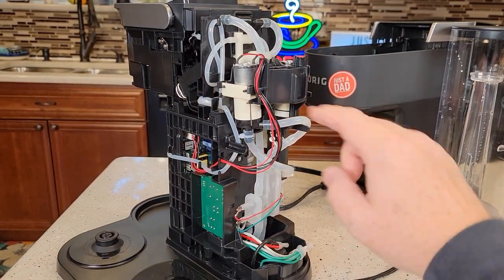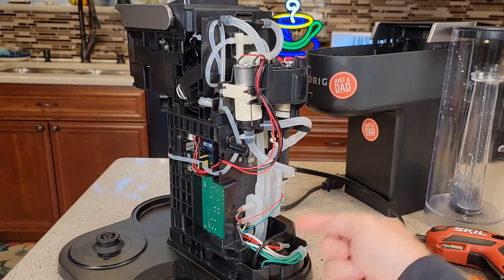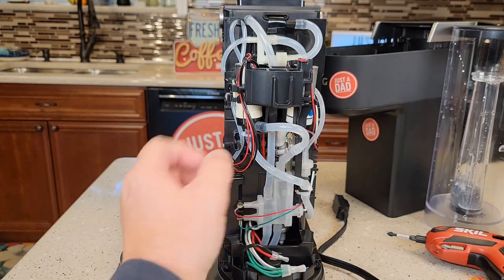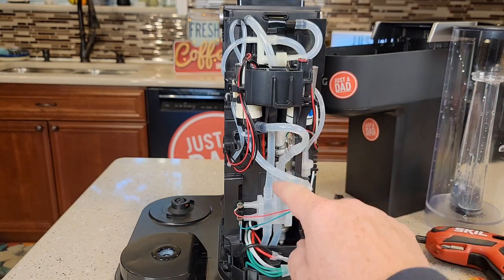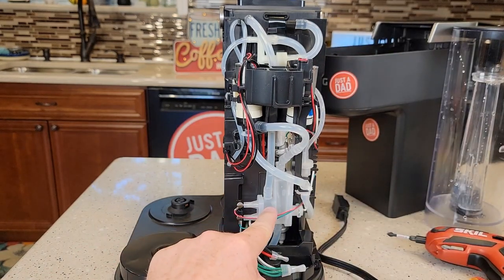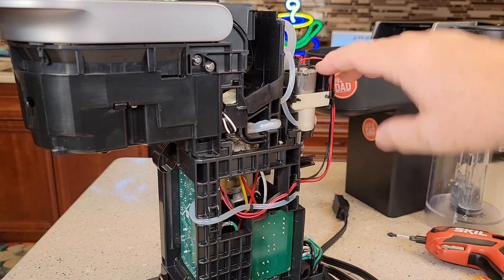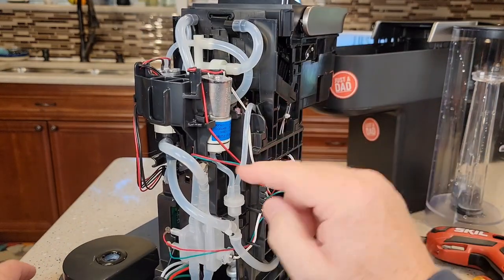So while we've got it open, we'll just take a look. Looks like we've got a water pump and an air pump. There's our low water sensor, and we've got like two chambers water comes up in. So I'll explain how the low water sensor works. You've got two tubes going to this reservoir. As the water reservoir is on there, water is going to go into two tubes. One tube goes right to the water pump and it sucks and puts it into your K cup. The other one is for this little box and it goes to a vent tube so that the water can raise up and down in there — that's going to give you your low water light, and there's a vent up here. So this tube right here is the low water, and these are your low water sensor wires. This tube right up here goes to a vent right there, and it's just an opening. So if your low water sensor is not working, you may have like a bug or something that got in there and covered that up. Here's the water pump and there is an air pump on the other side — it only has one line.